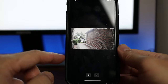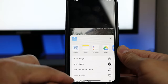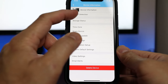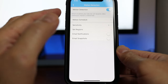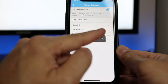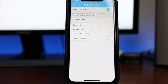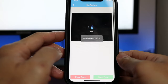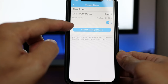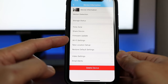Going back to the main app page, you have devices and events — another location to view recorded footage from the micro SD card, but there is still no option to download the footage. There will be a magnifying glass icon on the footage, and when you click it there is a download button, but it will only save the snapshot. There is also a share option, but the same thing — it will only save and share the snapshot image. In the camera's live view, the gear icon on the upper right corner opens settings. You have device information, motion detection where you can turn it on or off, motion scheduling, and PIR sensitivity adjustable from 1 to 6. However, when you exit and re-enter the settings, the sensitivity resets to 0. You can set motion regions, but it prompts a fail to get config error, so you will not be able to set motion zones. Storage status shows the micro SD card and is where you can format the card. There is also time zone, share device, and firmware update — but it says this version does not support cloud updating, so I cannot update the firmware.